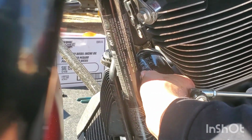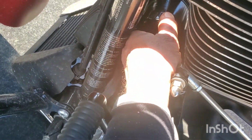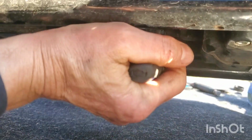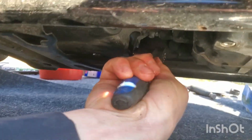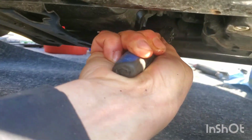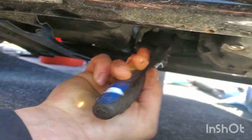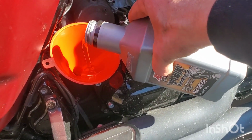Okay. Once that gasket hits, I mean, you just need... That's it, right? Right there. And that's good. All right, get the new seal on. A little pipe dope. And once again, 14 to 21 foot-pounds. Beep, beep, beep, beep, click, click, click, click. She's good.